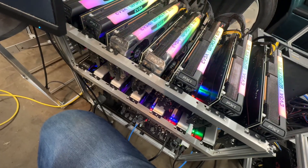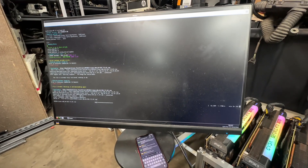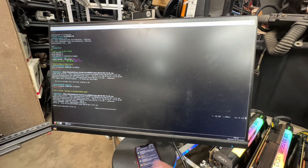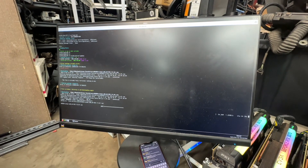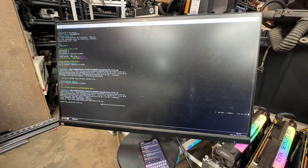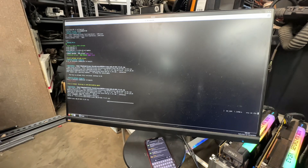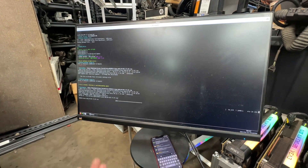I have to imagine there's some issue with a riser or something. After disconnecting all the GPUs again, booting it, and still having issues, it looked like memory. So I grabbed a different memory DIMM, and so far it's working. I'm going to run the driver updater and try mining on three GPUs. If three works, I'll go one by one, rebooting over and over again. Hopefully it was just the memory.